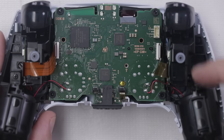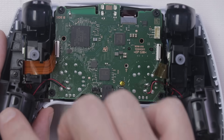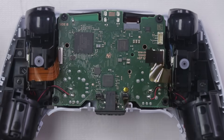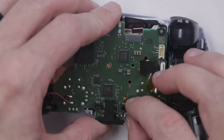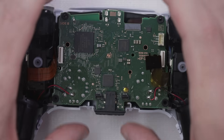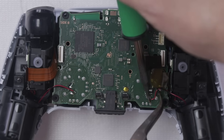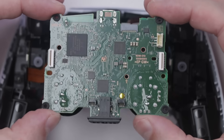Now on this DualSense, we can't take any of this out without first removing the motherboard, as it's all connected to this black casing right here. We've got to get this motherboard out, then we can see if it is all one piece. Now with the motherboard loose, I'm going to desolder these wires from the board so we can just pull the motherboard totally out. And now the board's ready to just come right out.